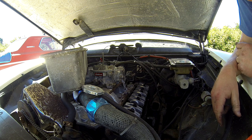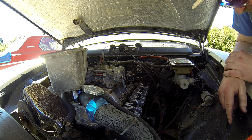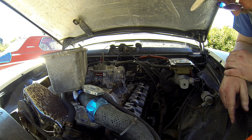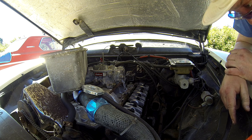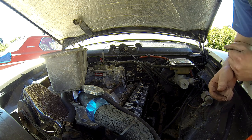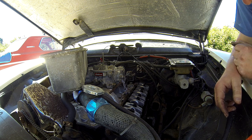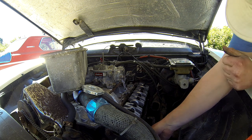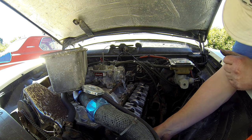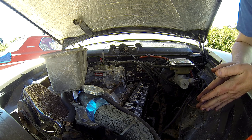Archie has a Chevy technique. Anyway, that's not too bad at all, really. Happy about that. I don't even know that the engine isn't stuck, to be honest with you. If we can get most of these plugs out, I'm going to turn it over by hand and make sure we're not starting from there, because otherwise there'll have to be an operation. Anyway, this is positive.